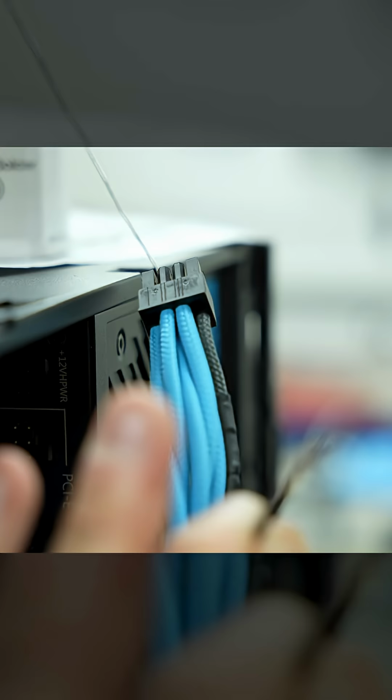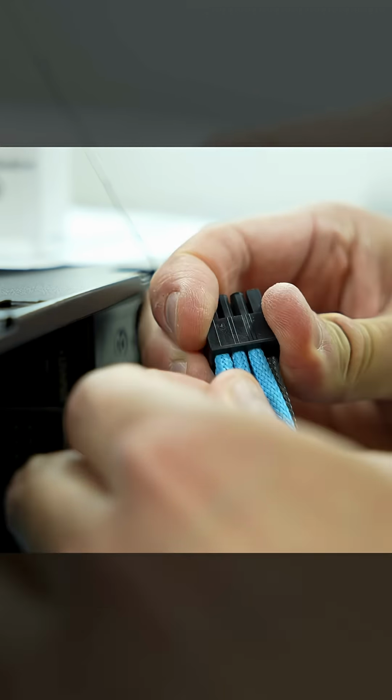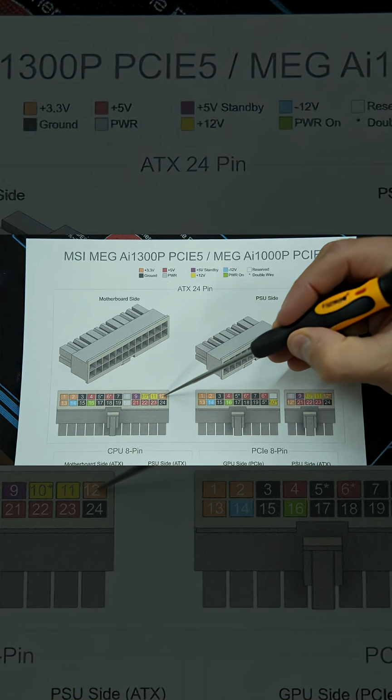Over the years I've tried several different methods to make split wires. The one I'm going to show you is by far the easiest and most reliable. To demonstrate the process, let's say that this is the wire coming from your 12 pin of your motherboard connector, already trimmed to the correct length.